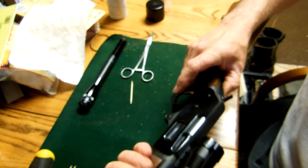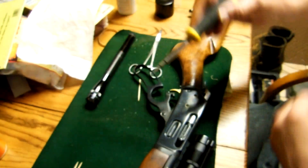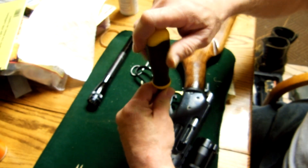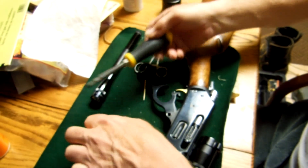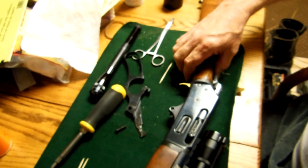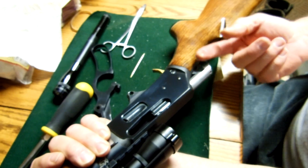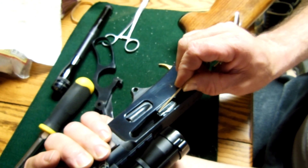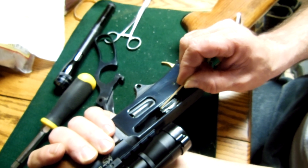To do that, first I just break the bolt open just a little bit. Then, see this screw right here — this hinge screw — that's got to go. Take that screw out and lay it aside. Then you've got to pull the bolt out. Now here's an important note: this is a round cylinder bolt, but right here is a little spring tab that has corners that are not within the cylinder. These are drag points, just so you know what to focus on.